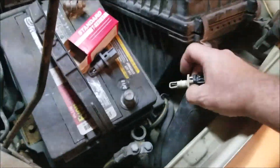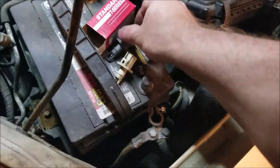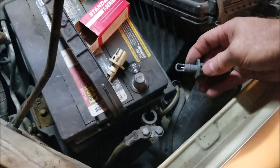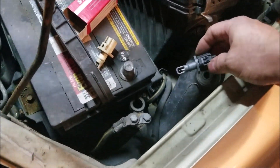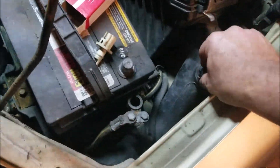Try and do this one-handed and hold the camera — it's a little challenging — but anyway, you pop that out, pop the new sensor in. Again, we had gotten an air temp sensor error, so we'll just put that in there.